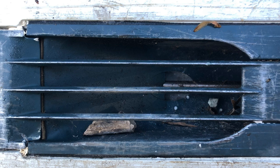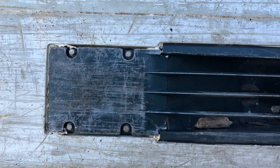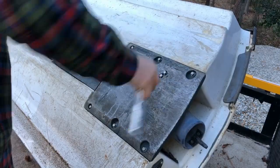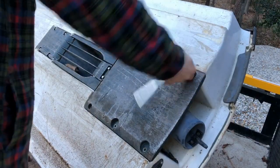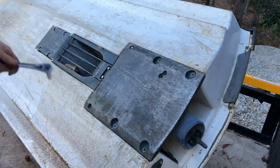Underneath the bottom of the hull you can see the grate covering the intake for the pump, and here's another picture looking inside the pump. I'll certainly utilize this whole assembly on the bottom of the canoe. It's simply bolted on in a handful of locations — probably a dozen or more bolts, about a 12 millimeter bolt head. All you needed was a Phillips head number two screwdriver and a 10, 12, or 14 millimeter socket to disassemble basically everything. It really didn't take a whole bunch of tools.